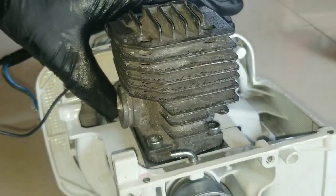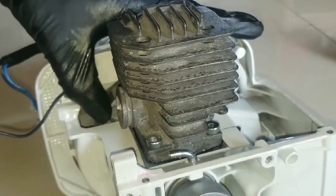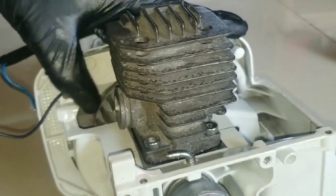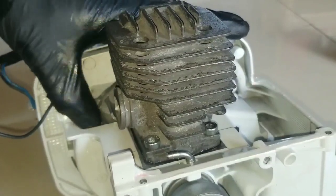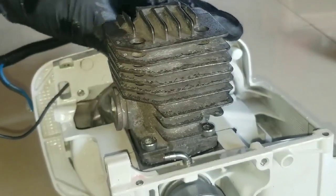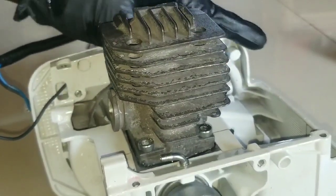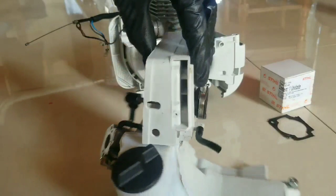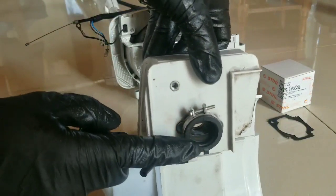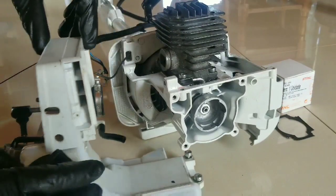Before completing the assembly, putting on the fuel tank and the gas tank, you just want to turn the flywheel. And in doing so, you're going to hear the compression. So you could hear that. So once you have this smooth rotation, it means everything is perfectly assembled. Here I have the assembly. This is the fuel tank where the carburetor is going to be bolted. So you see, this is the part that will have to get fit onto the engine here. So it will be going like this.